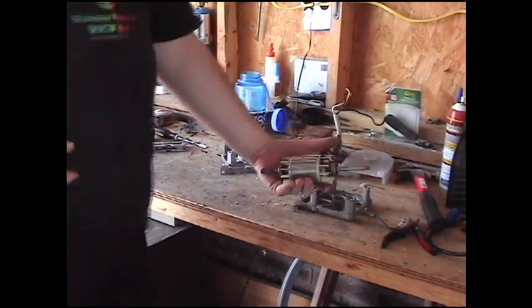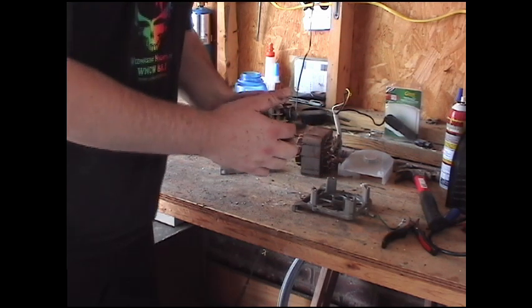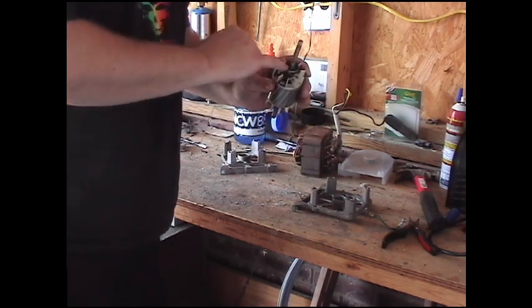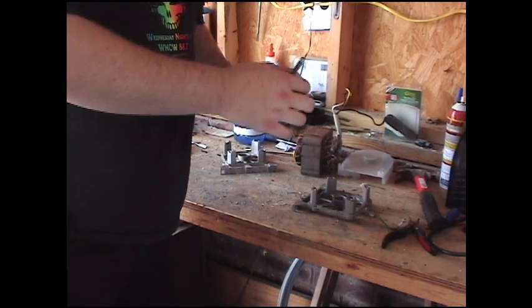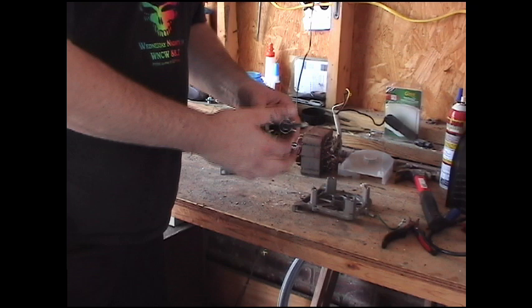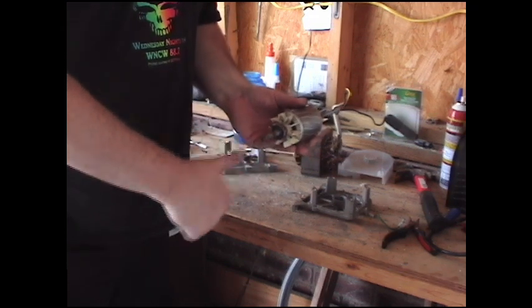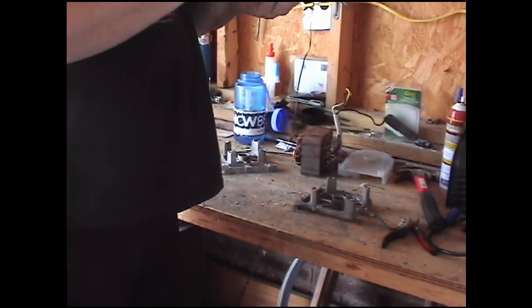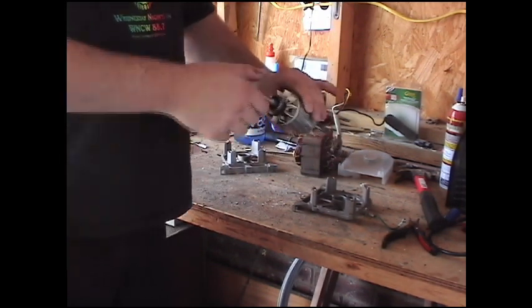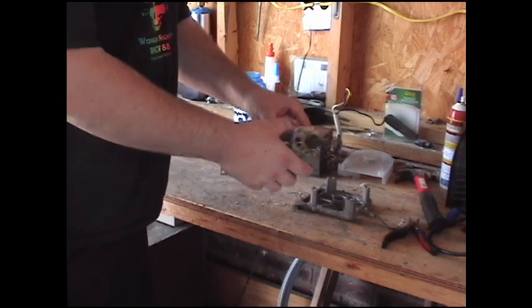On that you've got your two bearings here. I've already cleaned them up a little bit, but that front bearing was just downright nasty — there was black crud. It looked like it had chewed itself up and spit everything out on the inside, and it will not spin at all. This rear bearing looks great, real smooth. I went ahead and ordered two of these — they're actually 6000RZ bearings: 6, 0, 0, 0, Romeo Zulu.